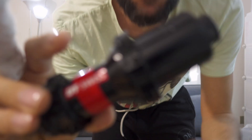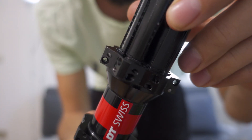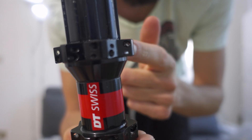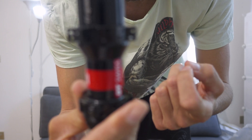Speaking about the hub — this is, as I already told you, a straight pull hub. I kinda like it because it's really simple: you just need to insert the spokes in the correct pattern and you already know where the spokes are going to be inside the rim. Professional wheel builders don't like straight pull technology as much and prefer traditional J-bend spokes, but I kinda like it.